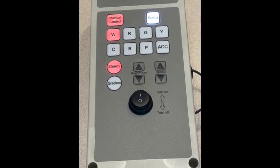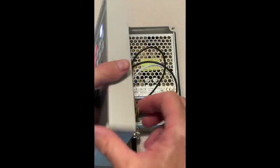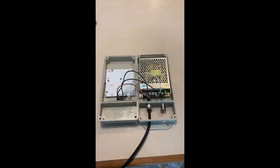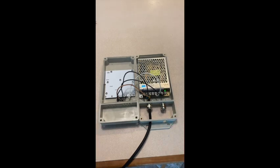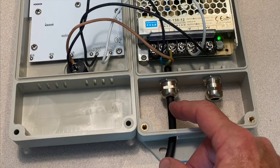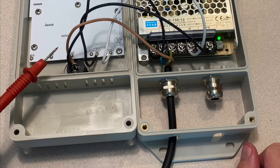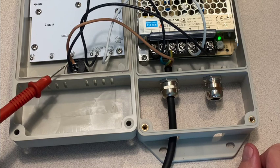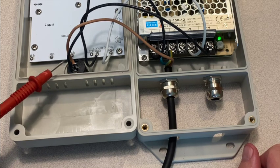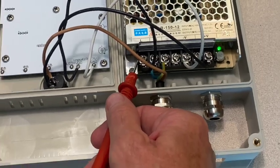In order to work on this unit you have to take four screws out of each of the corners, which allows you to open up the box. Here is the inside of the box. Here is my 120 volt lead coming in — that lead comes in with a brown wire, which is the line wire, and it comes over here to the on/off switch. The other side is a black wire that comes over here to a terminal on the transformer.